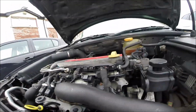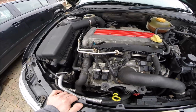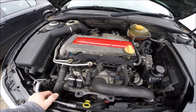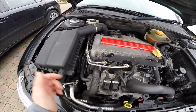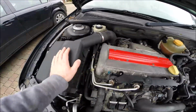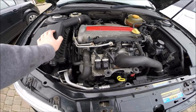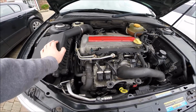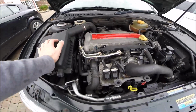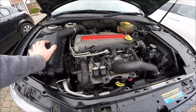So only two options are left to check: the fuel injectors with a faulty head, where the spray of petrol is really wrong, maybe some leaking or something like that. And the last option would be the timing chain. The timing chain was replaced two years ago for the previous customer, so I'm not sure, maybe one of the camshafts is in the wrong position, because I have the timing over the limit.